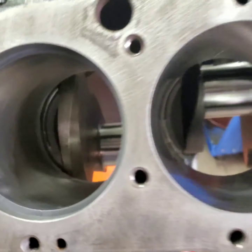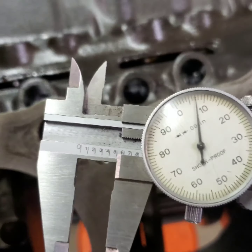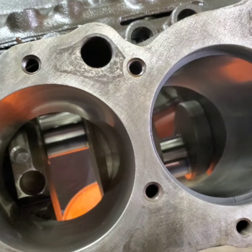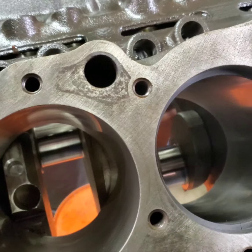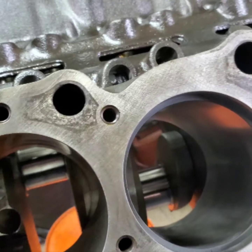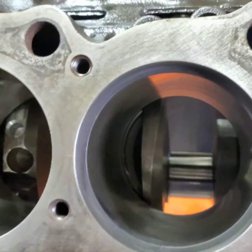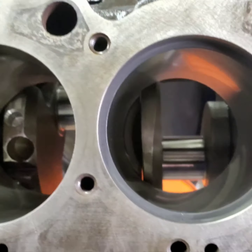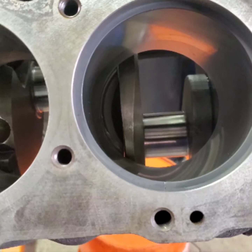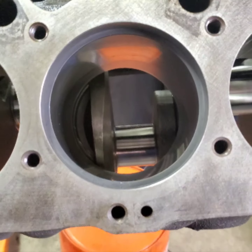Okay, also today we put our rings down there about 500 thousandths. I got my caliper here, about 507 thousandths, but basically about a half inch. And I do this different ways. Sometimes I use a combination square, but you can see I went around. You always want to make sure you pull the ring up against it, so it's nice and square in the bore. You can see, so around a half inch. So typically I put it down about a half inch on a fresh bore, between a half and 1 inch.